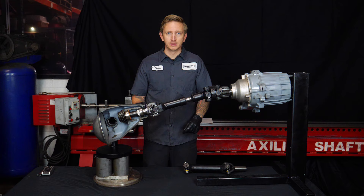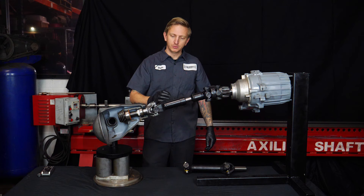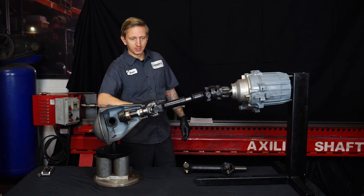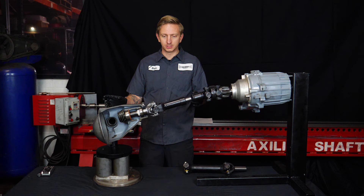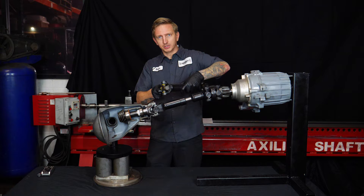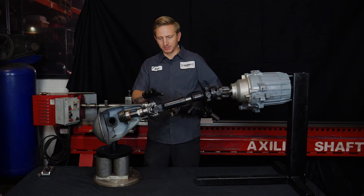The reason we want about two degrees of pinion offset has two explanations. On a vehicle with leaf springs, under load the wheels and axle are trying to rotate in opposite directions, causing axle wrap. If you start at two degrees of offset, axle wrap of four degrees cycles you from two down to zero and back to two, staying within a safe window. If you start at zero, it goes from zero to four and you get vibration. On a vehicle with coil springs and control arms — like a TJ or XJ — there's no axle wrap, but you still want a small joint angle so the needle bearings in the u-joints move slightly. If they're stationary they'll wear grooves in the trunnions, so one to three degrees is ideal.